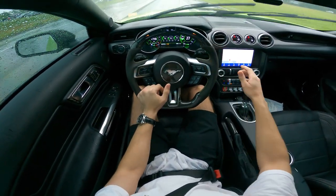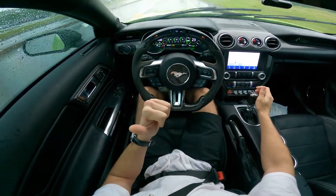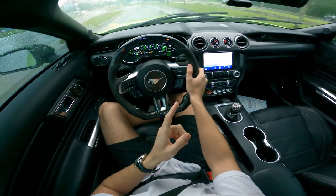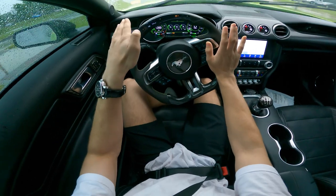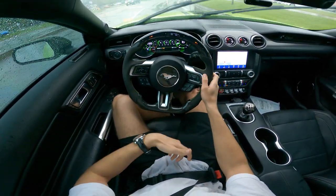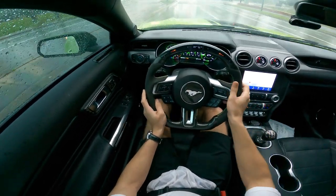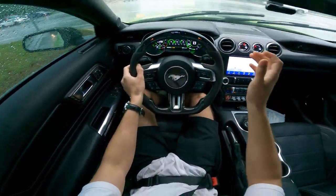So we're going to do that real quick. This is rev matching — I'm going 23 miles an hour in third gear and I want to go to second. Clutch in, blip the throttle. That was an over-rev — I need more practice. I obviously haven't done this since I had the auto rev match. What I was trying to do was put the clutch in, blip the throttle to 2300 RPMs, and then go back to second gear, because that's how many RPMs I had when I was going 23 miles an hour in second gear. And I did it smoothly that time. It just takes practice.